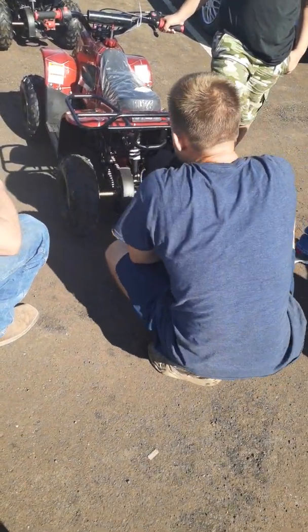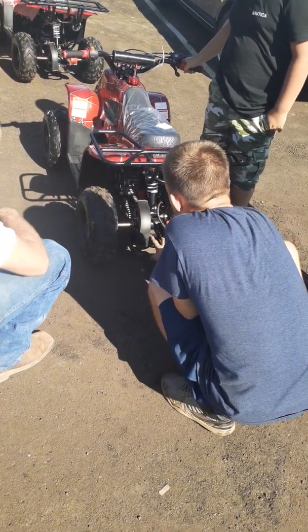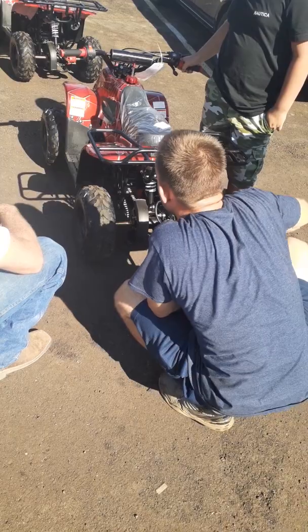Once you've found your desired tension, go ahead and lock in your lower 2 again, lock in your upper 2, and then replace your rear lock nuts, and that's going to keep your whole rear end tight.